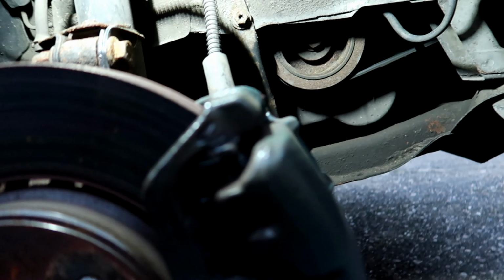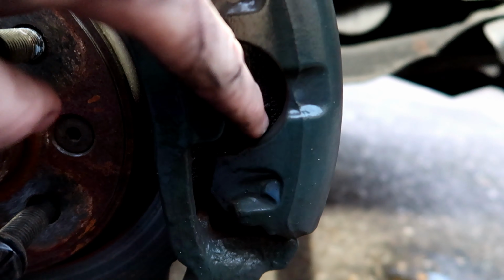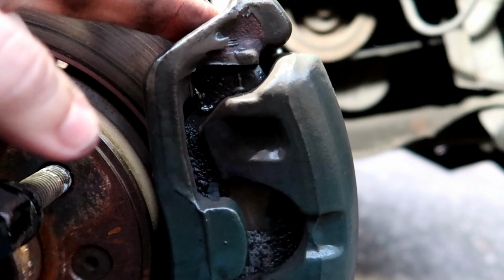Right, we've got the car up, starting with driver front. Got my inspection light. Let's have a look what we can see. I have looked at this a little bit off camera, but look at how hot those brakes got. Don't know if you'll be able to see that. It's all blistered. Oh, there you go. All the paint. I know the brakes got hot. They got to about 370 degrees after I'd done a cool down lap, so probably a little bit more.